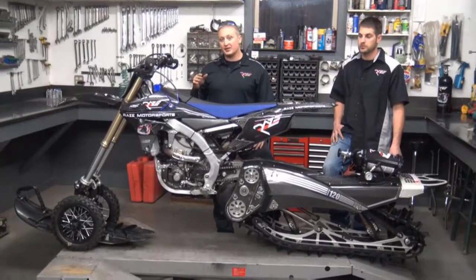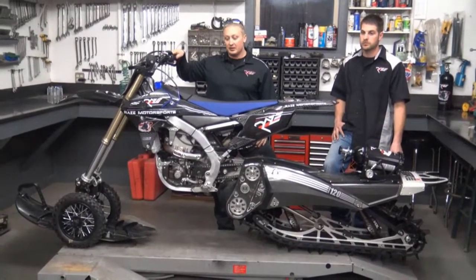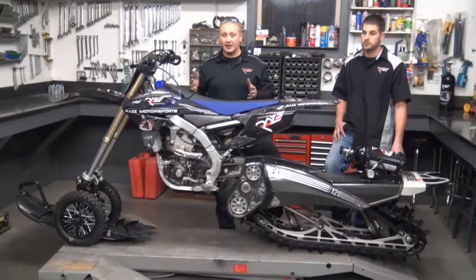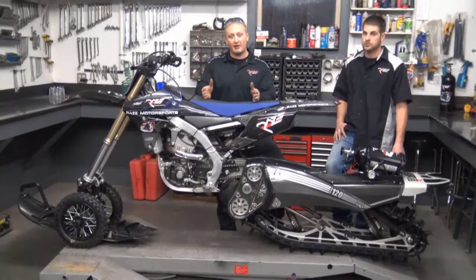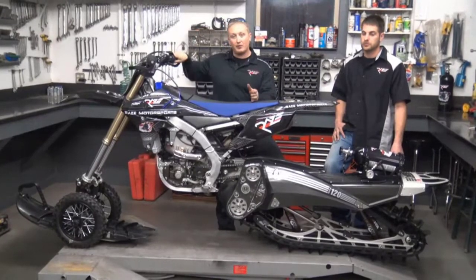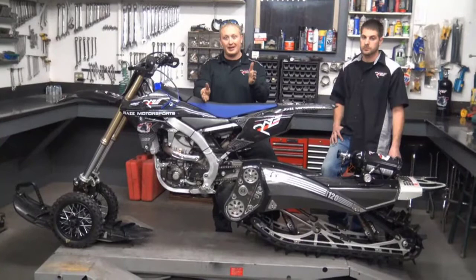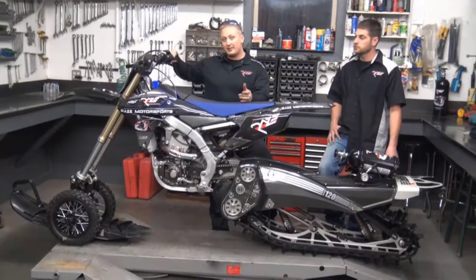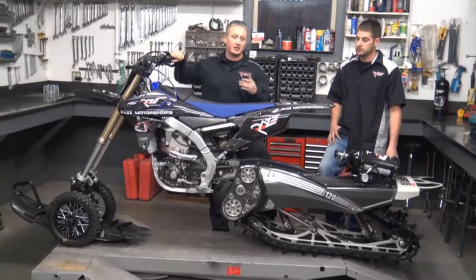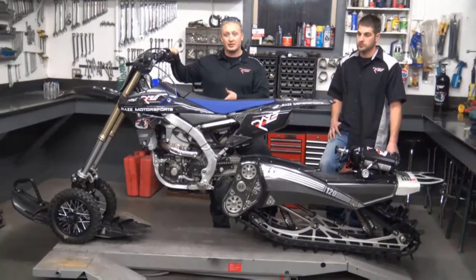If you're above 6,000 RPMs, 65% throttle input, you'll get your spray. We use this as a crank accelerator. So the ECU will shut the nitrous off in the background, even though you're at full throttle, at 10,500 RPMs. So it's going to come on at 6, shut off at 10.5. If you're climbing hills in 3rd gear, holding it wide open, your nitrous is going to shut off in the background. If you're climbing in 4th or even using 5th sometimes, you will be using the bottle.